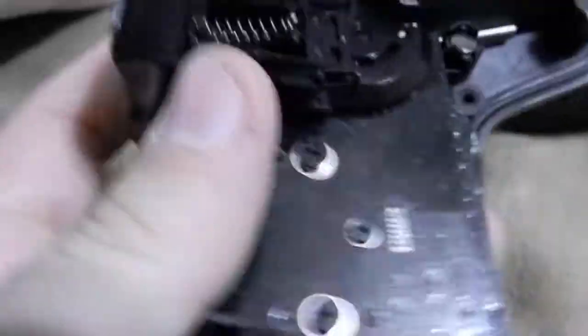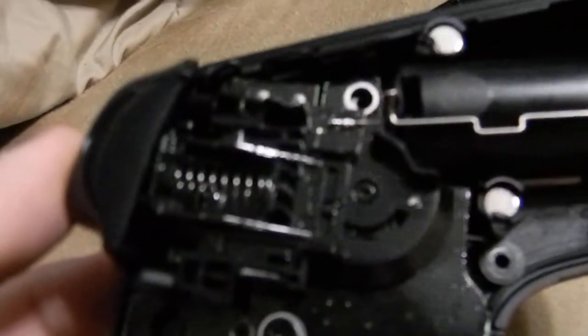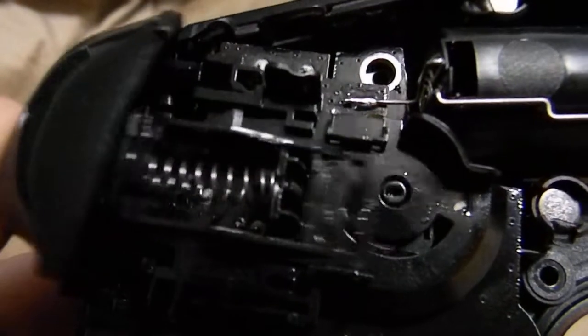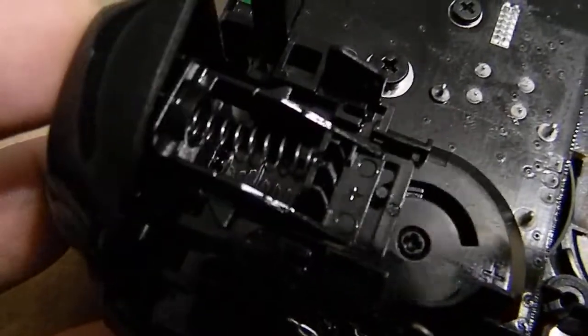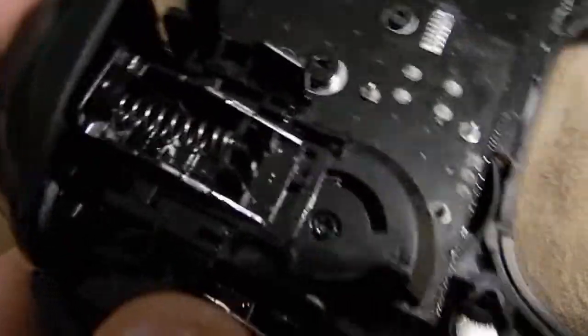Another thing with the flippers — now that I've modded the controller, the mechanism is butter smooth. It used to make a horrible squeaky noise. I fixed the squeaking problem using DuPont silicone Teflon lubricant, which you can buy at Lowe's, and it is plastic safe.